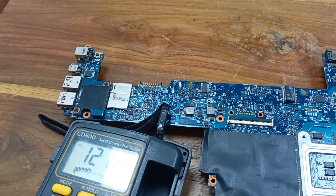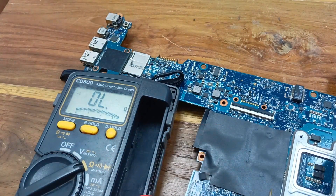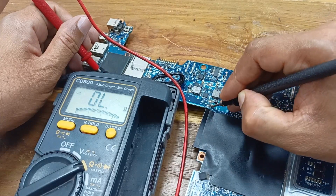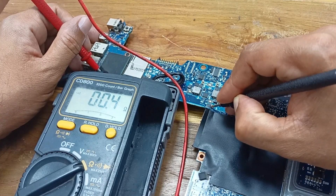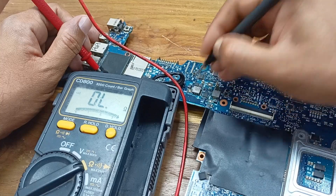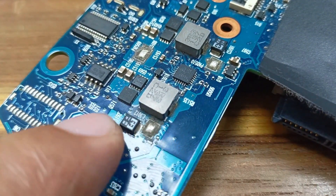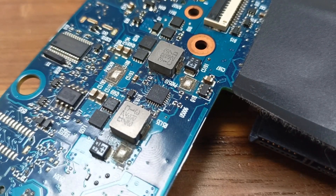Open the power cable. Set the meter to continuity mode — that is the ground pin. No short circuit. If there is any short circuit it will automatically give continuity and a beep. You can see here — this is connected to the ground pin, that is why it is giving continuity and a beep. But this one is not a short circuit, and here is also no short circuit. I'm getting 5 volt here so obviously no short circuit, and 19 volt is also present. I need to find the 3.3 volt. First I want to clean the circuit very properly. There is some dust and some damaged areas — this laptop was maybe kept unused for a long time.